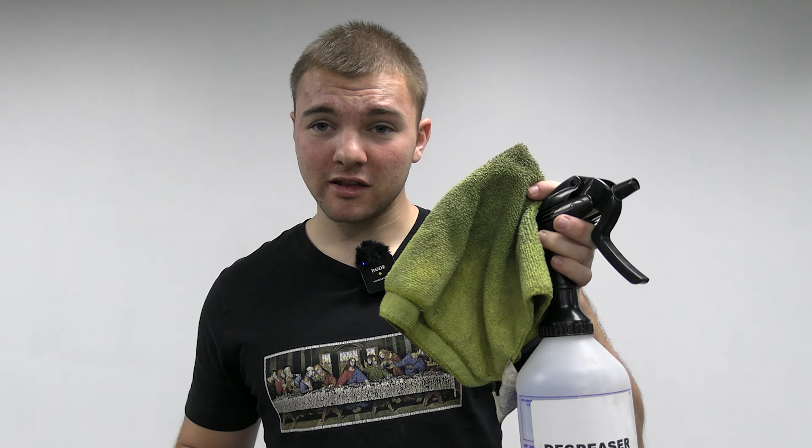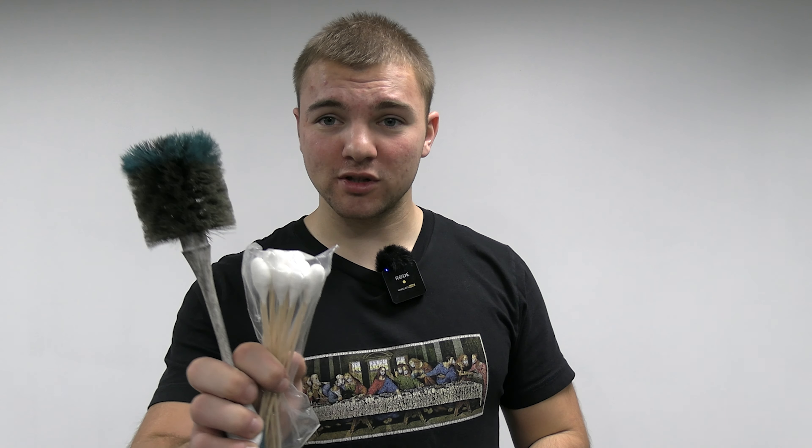There's a ton of different aluminum cleaners that you can use. You do not want to use the steel wool on the aluminum or else it will scratch it. We recommend Neverdull — that's what we use — but there's a million different types of aluminum cleaners if you'd rather use a different one. We use degreaser to get all the dirt, mud, or grime off of the bike or wheels. You're going to want to use a microfiber cloth, but for places you can't get to, a toilet brush is very useful or some swabs. You can always get degreaser at Walmart or anywhere online — it's pretty cheap and it works very well.